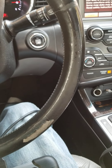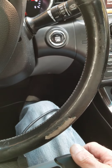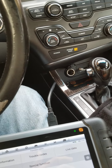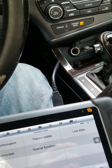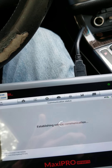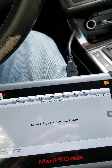My question is: would it make sense to clear the P1326 code and let the customer go on their way while we ordered an engine? I want to do a little experiment — it's no harm no foul since we're already getting a new engine. I have a scan tool out going to live data, because a lot of times just replacing the knock sensor will not fix the problem if there is any noise at all coming from the engine.